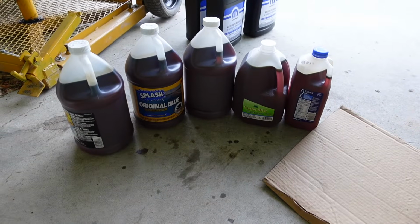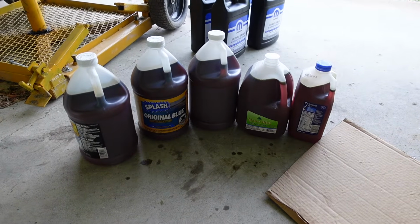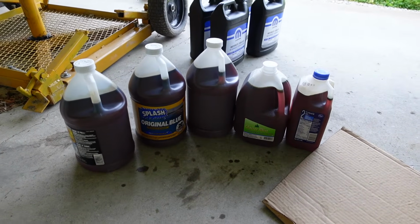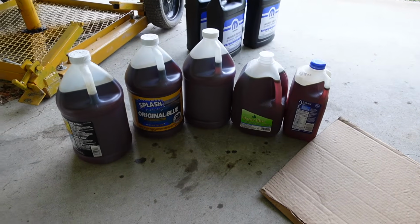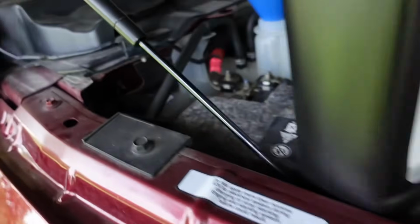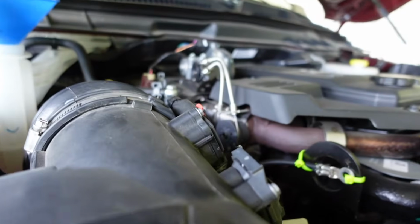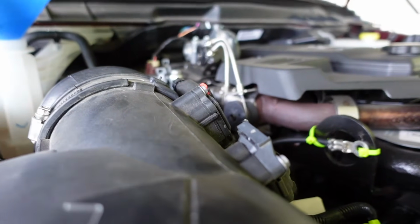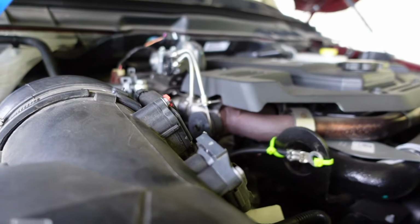Okay, we're getting ready to refill it, and we went ahead and tightened up the plastic drain on the side of the radiator very carefully. When you go back with that, don't force it. So what I ended up getting out was exactly 4.5 gallons. And I checked, the reservoir was empty. It did pull it all the way down. And also, guys, it's my understanding when you go to refill these, that I will not be able to get that 4.5 gallons back in it on the first try.